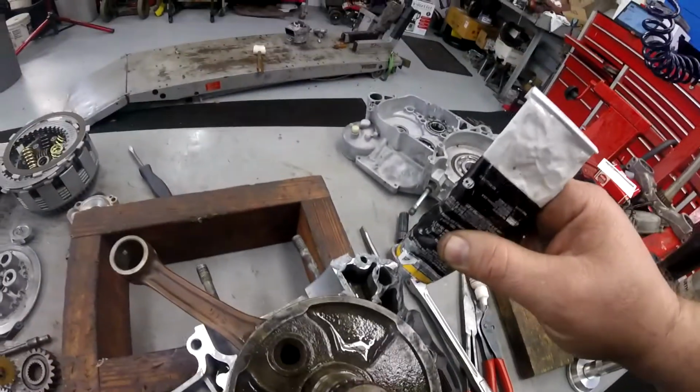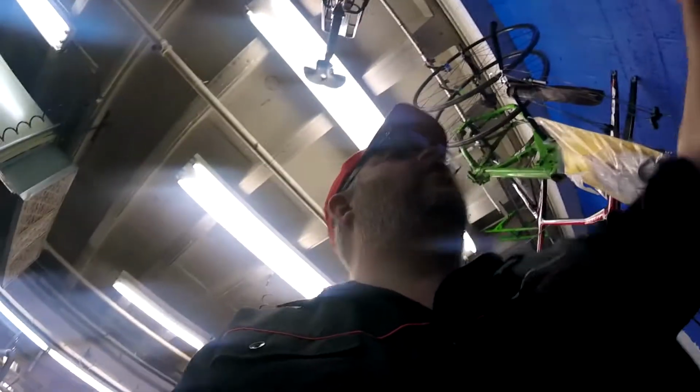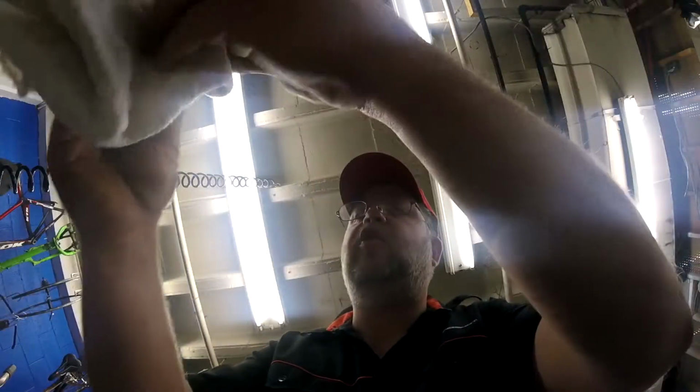What you definitely got to protect yourself from is any kind of an air leak. Any kind of an air leak whatsoever on a 2-stroke will lean your jetting out and blow you up quick, because, of course, it gets hotter. You ever hear those guys at the track say, man, my bike was running so good, and then all of a sudden it blew up? Well, the crank bearings probably got loose, letting the crank move in the orifice of the case, warbling out the seals, and developing air leaks. So you really got to watch that with the 2-strokes, guys. It's absolutely critical that you're not leaking any air.